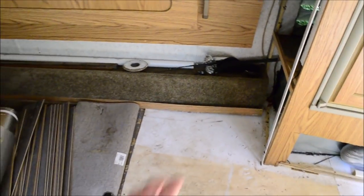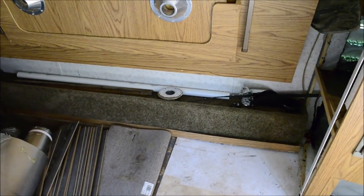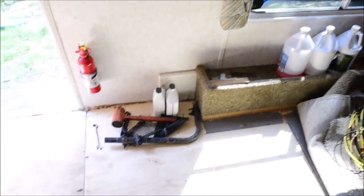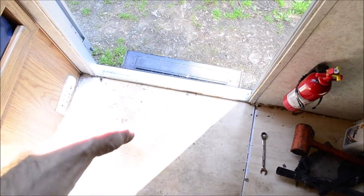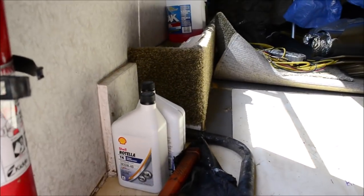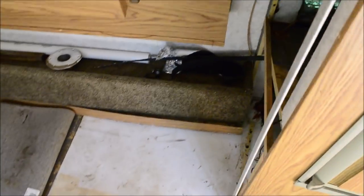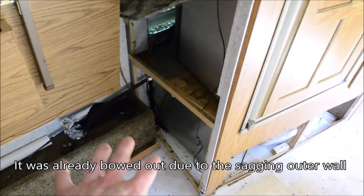Then in another video, I've got to lift that wall and support it with angle iron between the two outriggers. This wall is staying up fine because the stair assembly actually helps support the floor. So there's an outrigger there, there, there, and one up in there — plenty of support on this side. This side has lifted itself back up and it's pretty straight. This side is still crooked, so I need to add some support.